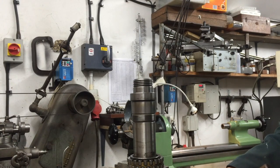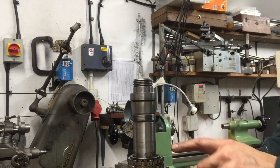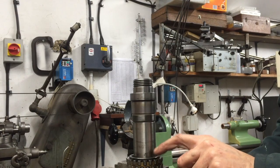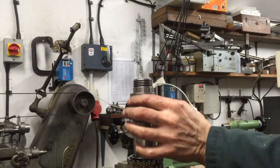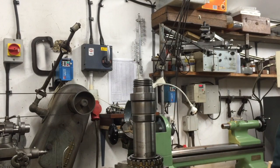Because I'm replacing the bearing I'm not worried about marking the outside of it. If you're going to reuse the bearing then obviously you want to look after it — keep it clean and not mark the outer case. The ideal thing is to use a tube which is a nice snug fit over the spindle to gently tap it out all the way around. It shouldn't be that difficult to remove once you start moving it.